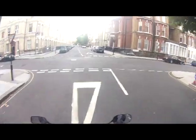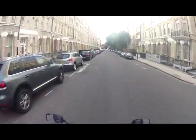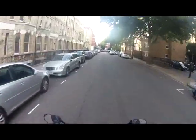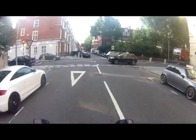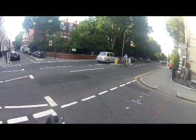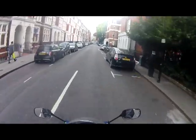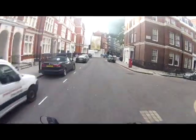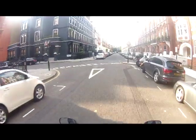I've been riding my new bike for a couple of weeks and it's going well. In the last video I put on a stubby carbon fibre exhaust, but to be honest it wasn't running very well when cold — I'm not sure if that's the cat or if it needs tuning due to the lack of back pressure. The stubby can sounds great, like some sort of race bike, but it looks rubbish and doesn't suit the bike.